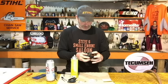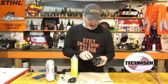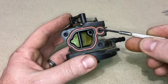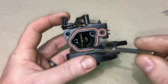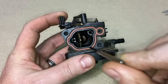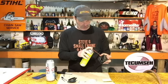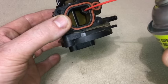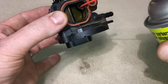There are two holes right where your air filter side is, where you see this red ring. If you open that choke up a little bit, you can see one hole on the left side deep down there, and one hole on the right side. We want to clean those. Start with the right side — that's the easy one. You just put your red tube in there and squirt it, and you'll see some spray dripping out the bottom, so you know that's clear.